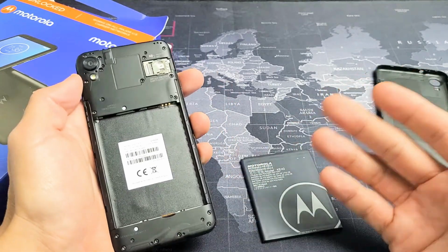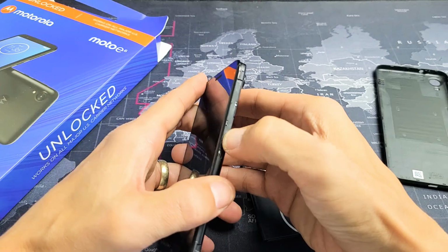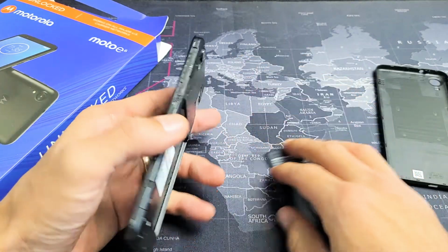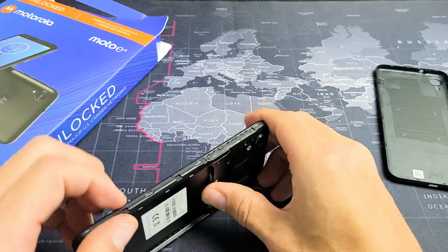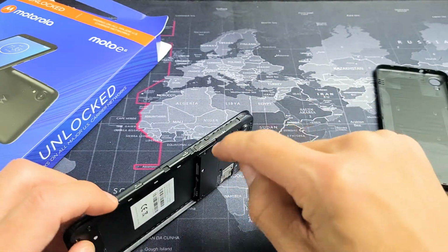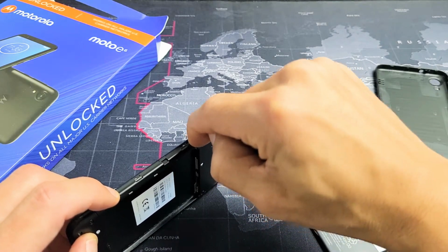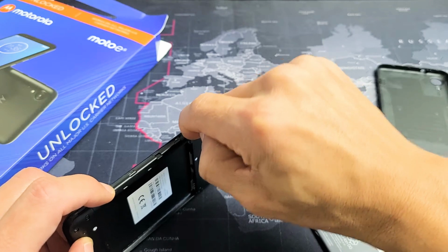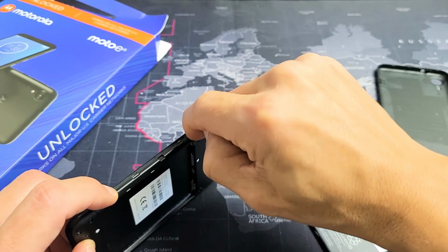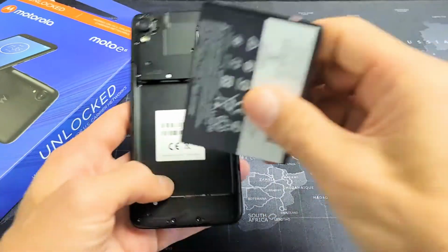However, if you try it 6 times and it's still not working, then there's a possibility that your power button may be stuck or something like that. So what you can do, again, make sure the battery is out. The power button is right here, just a little flat area. What you want to do is spam it. Just press in and out while the battery's out. Get it all nice and loose. Just go kind of crazy. In and out, in and out, like this. And then go ahead and put your battery back in.